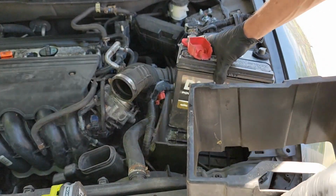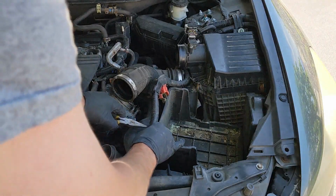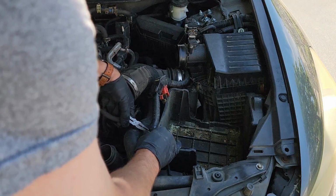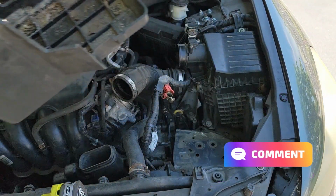Then you need to get a pair of pliers and detach the wire harness connected to the battery tray. Just squeeze the plastic tab and pull away from the tray. Once that's removed, you should be able to pull up on the battery tray to remove it. If you're having issues getting yours out, leave me a comment below.